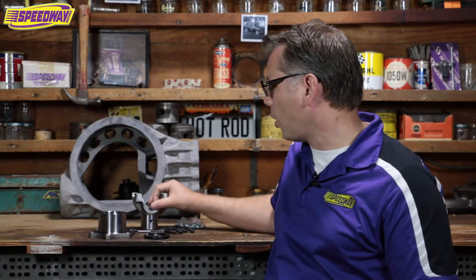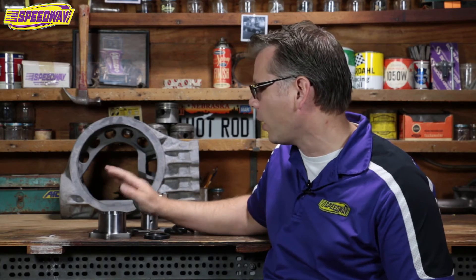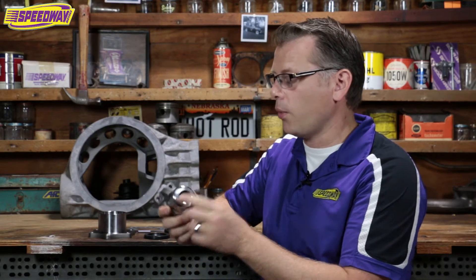If something breaks, it keeps everything all together, which is super cool. As far as this conversion kit goes — when I got my rear end home it was out of a '41 Ford sedan. I got it from a buddy of mine. It was pretty low mileage, so I wasn't going to tamper with it much — just clean it up, redo the brakes, and run the thing. But I did have to switch it over to an open drive line because I'm running a T5 transmission. I wanted the overdrive for heading down the highway, so I need to convert it over to a traditional driveshaft situation. So I bought this kit, and it is a really cool kit.